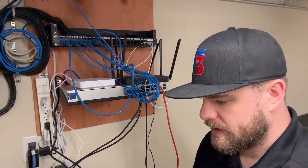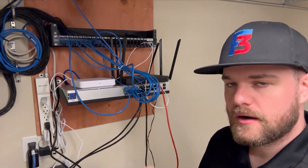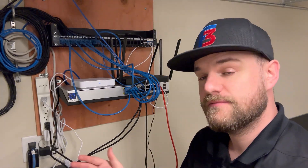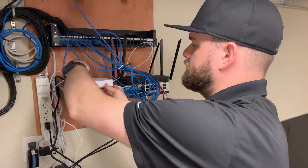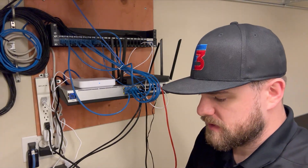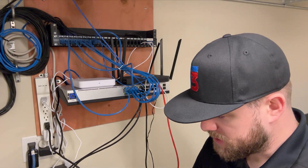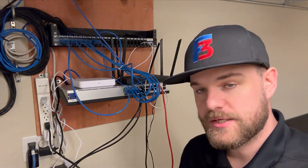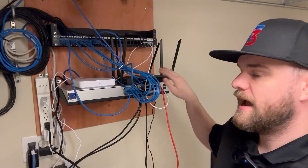Now that the router has powered on and connected to the UniFi, we are seeing a WAN 2 in place for T-Mobile USA, which is what we use for the SIM card in our routers. What we typically do is unplug the WAN 1 and see what happens as it transitions and fails over to this Pronto router. We just check to make sure the system comes back online. And that test seems to have worked - I am seeing WAN 1 offline, but WAN 2 for T-Mobile has kicked in and it's showing activity. I have my laptop plugged into the switch and I'm still able to browse websites, and checking the Pronto cloud controller we can see our router is showing online as well.